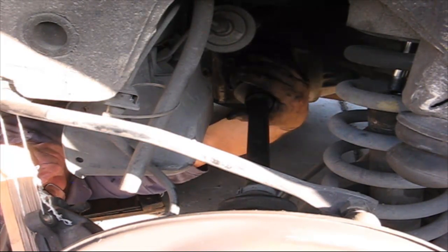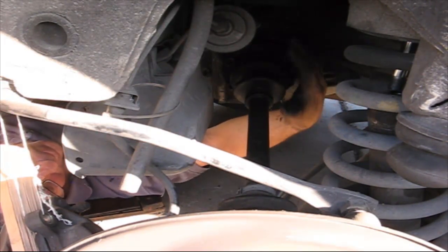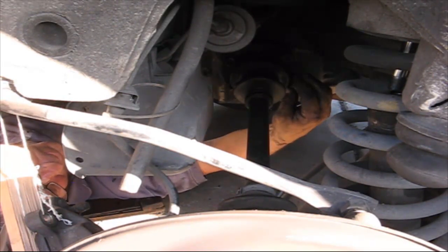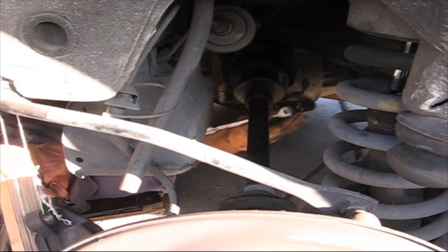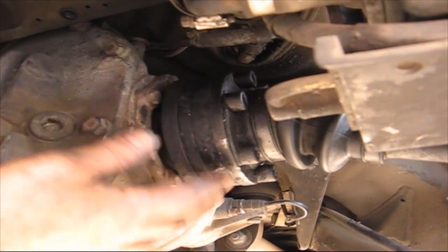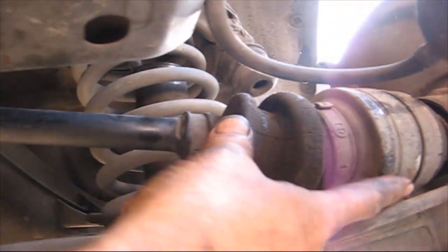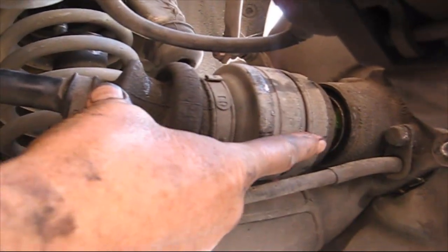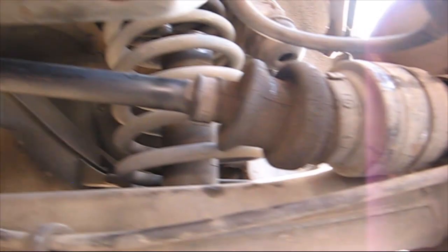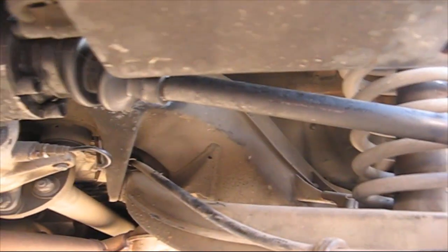Okay, I'm going to rotate this. I torque, just tighten this one down, one over here. Okay, so it's in a star pattern as much as I can. Here's what it looks like when it's installed. It's bolted here. Here's our repaired boot. Here's one of the clamps that we put on. And then if you look on this side, this is where it goes into the wheel. It had those splines over here. So that's the whole thing underneath.